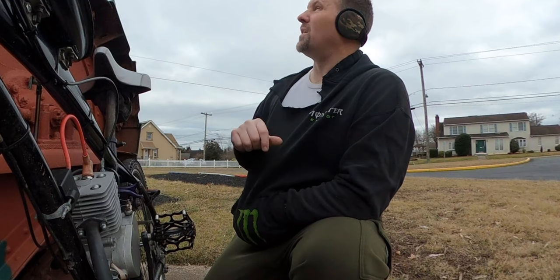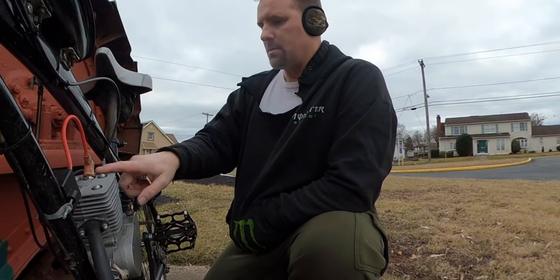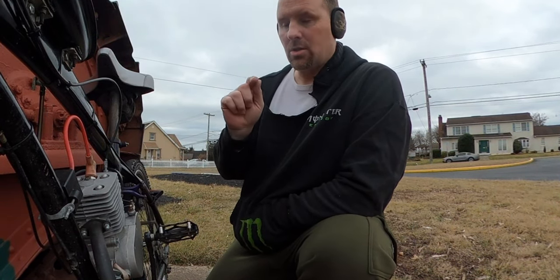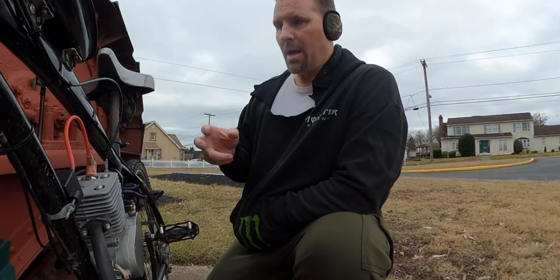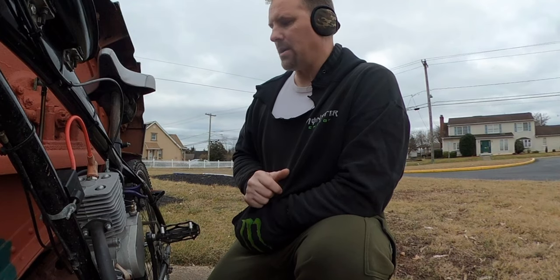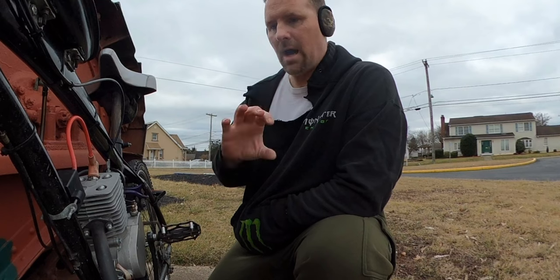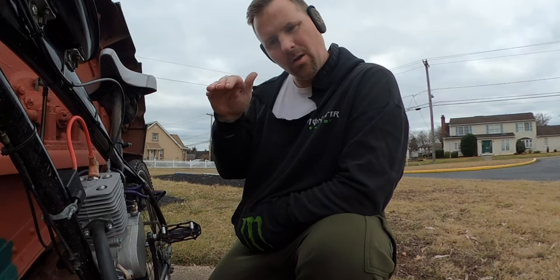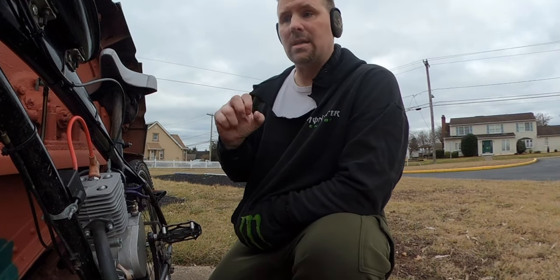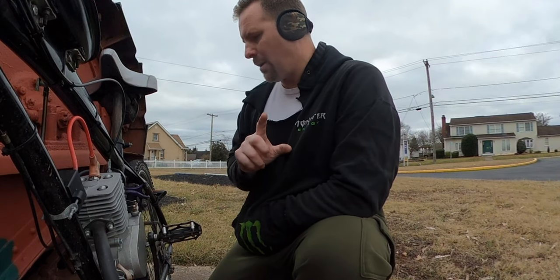I don't even think it was fully up to temperature yet, to be honest with you. Yeah, it's not. I mean, I'm touching the head. It's hot, don't get me wrong, but it's not as hot as it could be. I'm gonna go back and I'm gonna switch out with my gutted pipe, the modded exhaust pipe, see how it does if I gain my top end back and if I keep my bottom end grunt. That at the current moment only has a stock cap on. I don't remember if it's a cut off stinger or not, but it doesn't have any holes drilled in it. It's a stock cap to keep the sound quiet but leave the pressure free. So we're gonna try that out, see how that works with this.